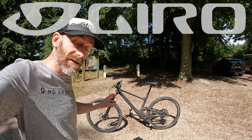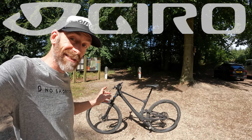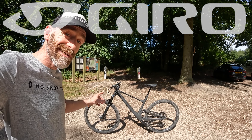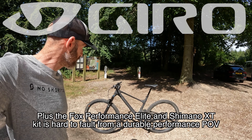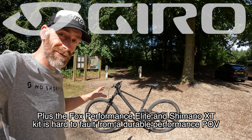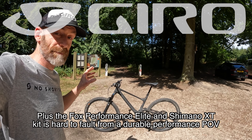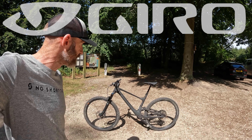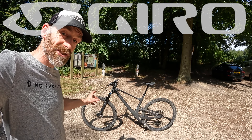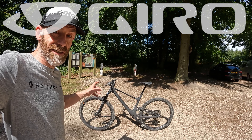Moving around to the offside, you've got a removable handle for the rear axle with a T25 and a 6mm Allen key on it — really useful for doing up bolts and any adjustments on the trail. Just whip that handle out and you don't have to rummage for your multi-tool. The rear brake sits on a separate arm, which leaves the rear flex stay free to bend and doesn't hinder the suspension movement in any way. It's also a 180mm post mount on the rear, so you've got a little bit more braking power through that single caliper XT.